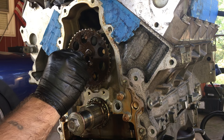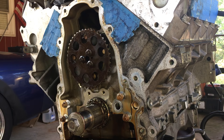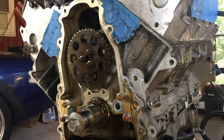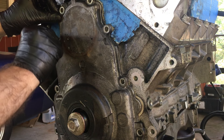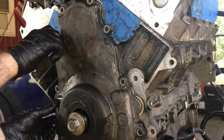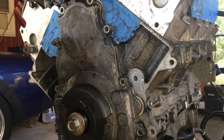It's getting a little bit late and the light is getting a bit dark so I'll come back in the morning and work on it. That's one advantage of having a garage — you just turn on the lights and keep working into the night. Just got those finger tight — want to be careful not to rotate that at all. I'll put the front timing cover back on. I did get a new front timing cover because this one is just trashed. I'll put a couple bolts in there lightly so I don't have to keep track of them. See y'all tomorrow.